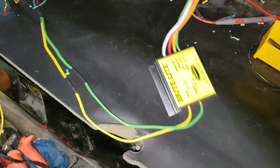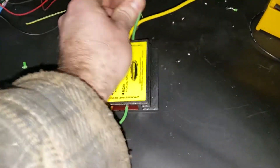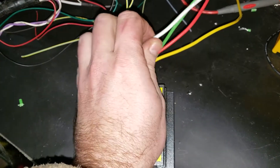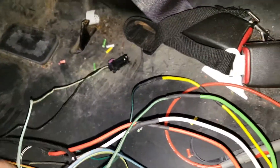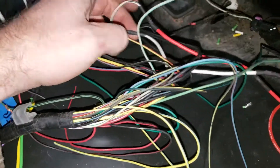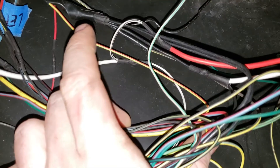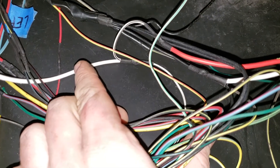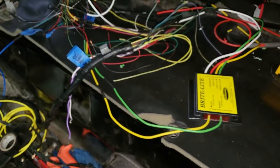I had to install a trailer brake adapter. What this does is take three signals — brake, left turn, right turn; the white is the ground — and turns them into just left and right tail light signals. For the center tail light I had to do a three-way split. The white and black wire coming off the VDC harness is the brake signal, so it gets three-way split: goes to the brake controller, and then the white and black on the Baja harness is also the center tail light, so both work correctly.